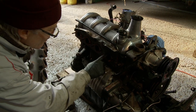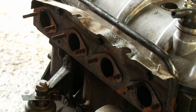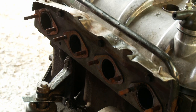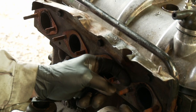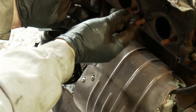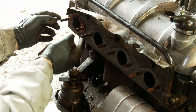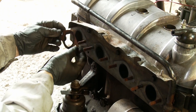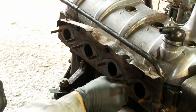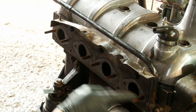Look at the gaskets — this one was possibly slightly blowing. These two are okay. I'll take the gaskets off. That was on the point of failure but still working. This one was fine, sealing okay. But you will not reuse exhaust gaskets. That one also getting to the point of failure — not quite leaking but was on the way. And we've got a couple of loose studs which I'll put back in later. But overall this is in not bad condition.